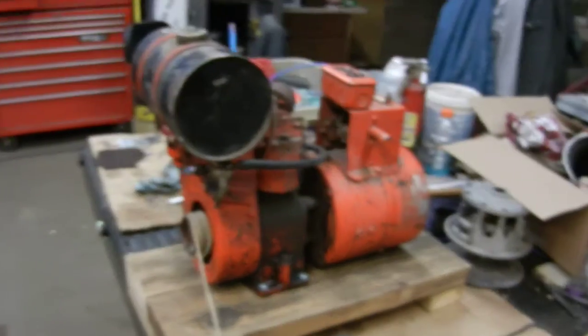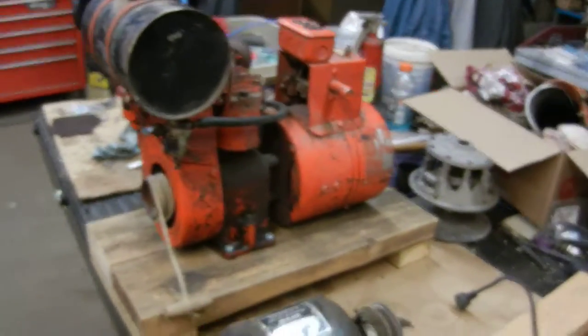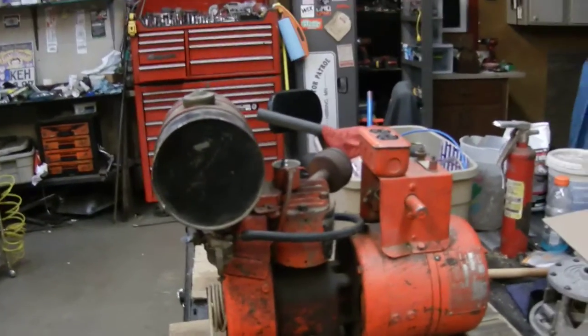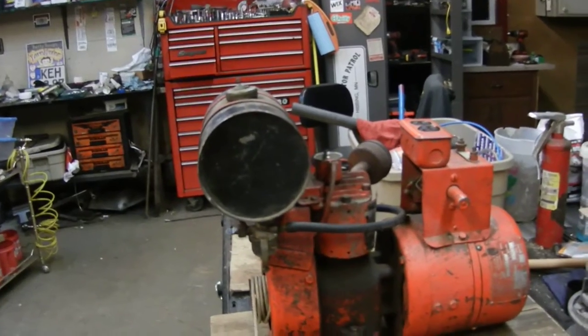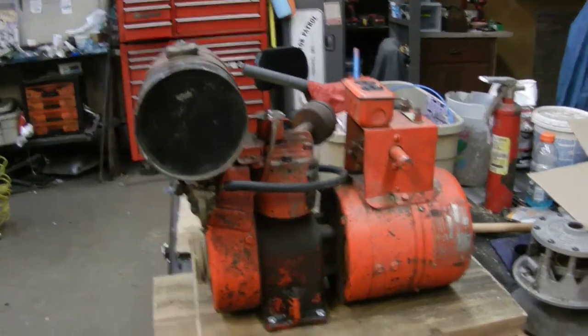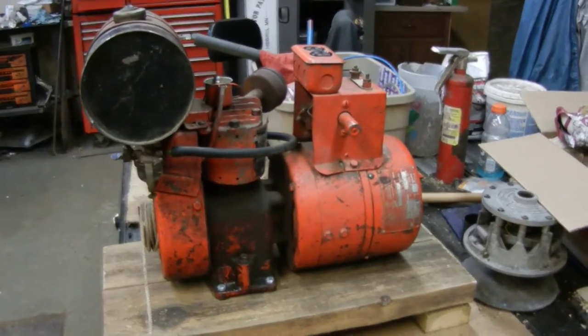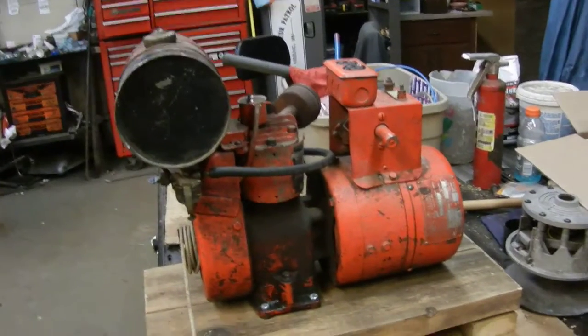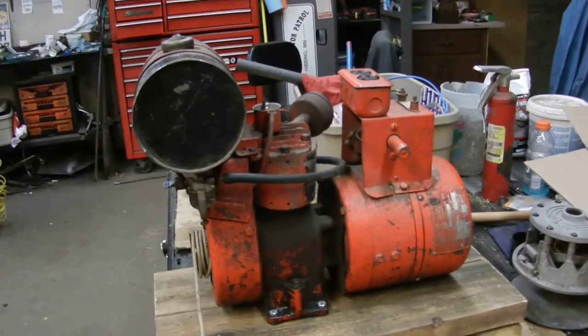Service appliance, clean the carburetor. This is not the original color either, by the way. Somebody has rebuilt this before. The cross hatch on the piston is gone, and by the way, it's a 2-inch bore, 3-inch stroke. But having gone 74 years, I think somebody probably rebuilt it, because it works now.